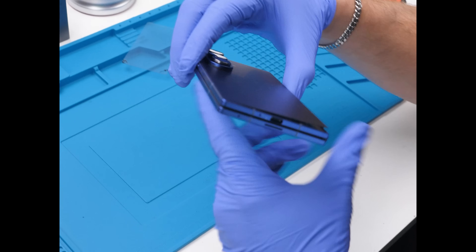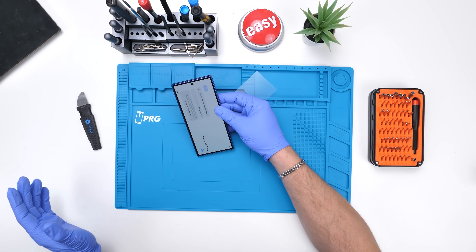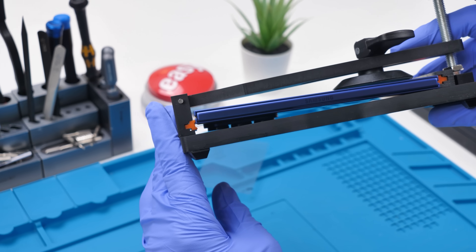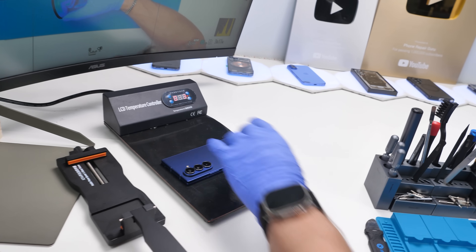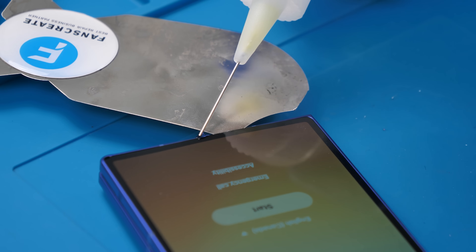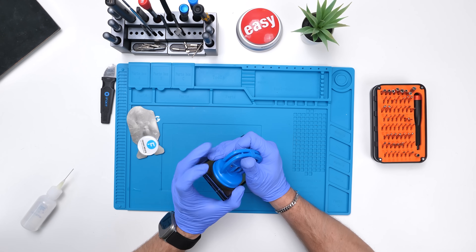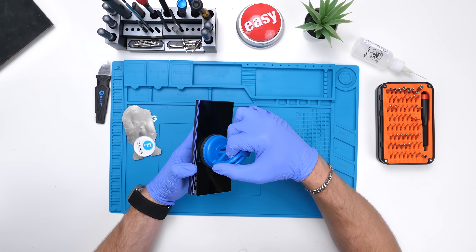This one's ready to come off. It does look different, but we're going to do this side first so we can take off both at the same time. Unfortunately, this was not as easy — the camera bumps made it impossible to use the clamp properly, so I had to resort to just using a suction cup and plenty of heat, and then a thin metal pry tool to wedge a gap and allow the alcohol to soften the adhesive. Just getting the display to lift up from the frame took about 15 minutes, which is extremely long.